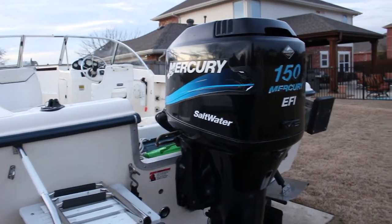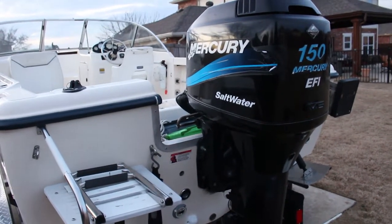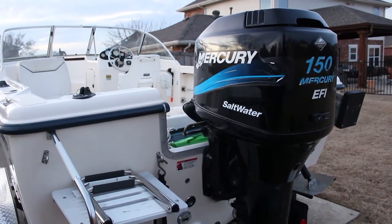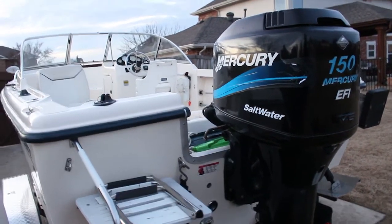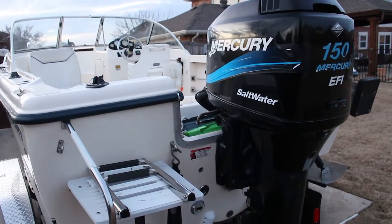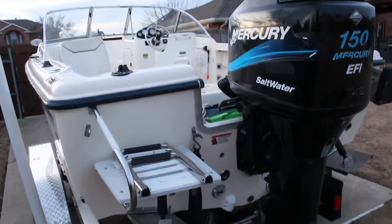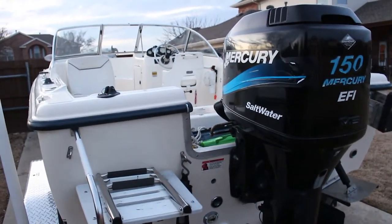If you're cranking the motor, one of the ways you can do a compression test, I recommend you take it to your mechanic to have him check it out. But if you're confident enough, when you're cranking the engine, if it's a 4-cylinder engine, this is a 6, and you hear it go through a cycle, like 1, 2, 3, 4, it should sound the same as it's going through. If it goes wing, wing, there's no compression in one of the cylinders. It'll just spin right through.